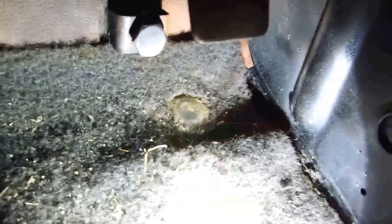I didn't realize this — on a gas pedal, there is actually a bolt behind the gas pedal. You can screw this down so you can get more travel for the gas pedal to get full throttle on a carburetor. It's got about over 95 percent full throttle and I think that's good enough. So if your Toyota carburetor isn't getting enough throttle by pushing down the gas pedal all the way, it's this bolt behind the pedal — screw that down and get more full throttle out of it.